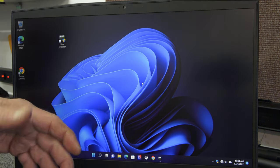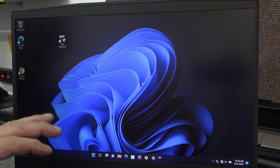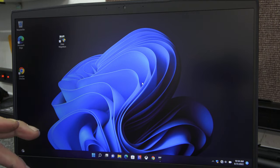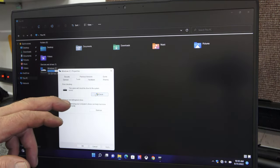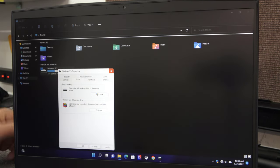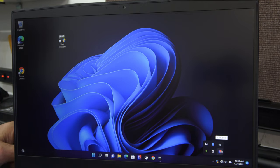Also, I always like to turn off power management so it doesn't go into sleep mode during the clone. Don't be connected to the internet when you clone — you don't want updates downloading or a reboot happening. If you have a lot of data it's going to take longer; this should go really quick because it's basically a clean Windows 11 install. If you've got a lot of stuff on your drive, right-click on the C drive, go to Properties, then Tools, and run a check to scan for any errors.